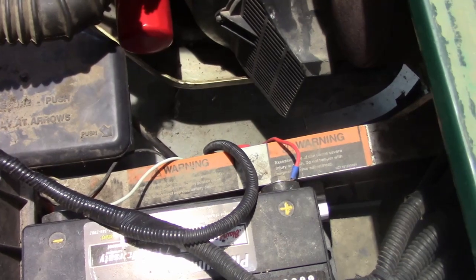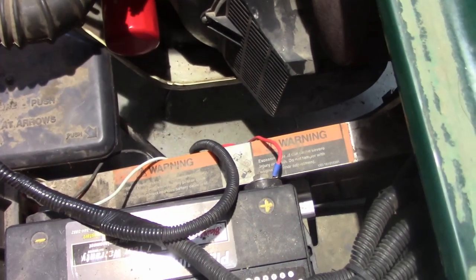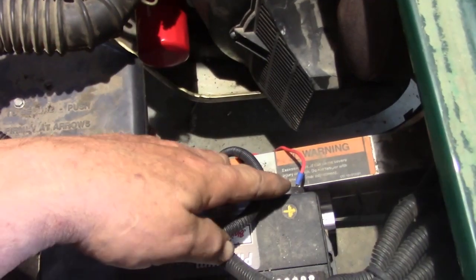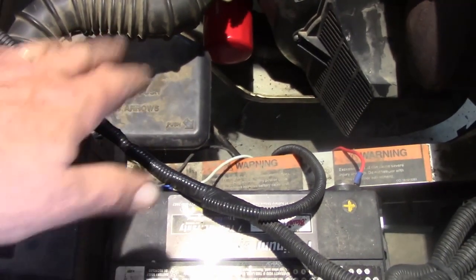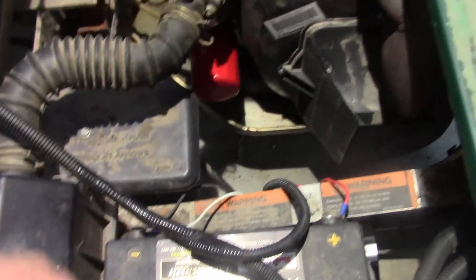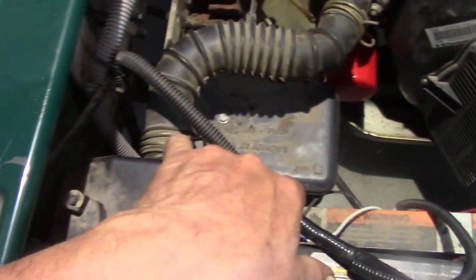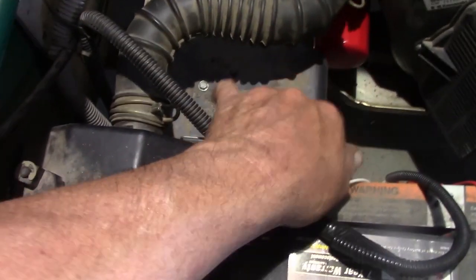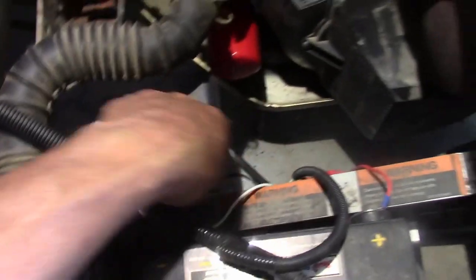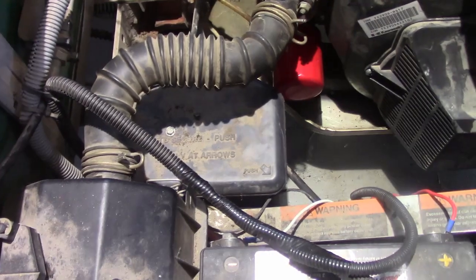Well, on just about any repair video or service manual, before doing anything on a piece of equipment — like checking the tire pressure or changing the oil — you should disconnect the battery terminal. In this case, today we're actually going to follow that advice and remove the negative battery terminal because we're working on electrics. After we remove that, we'll disconnect the air intake hose because it's in the way of the cover we have to remove. We take out this screw — it's got a 5/16ths head — then you push on the upper corners of this box top, and it'll come right off, and our micro-switches are underneath that.